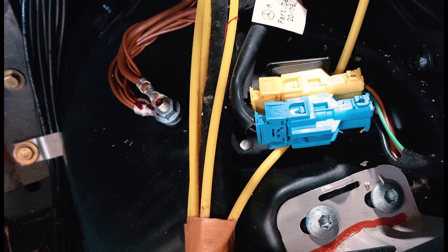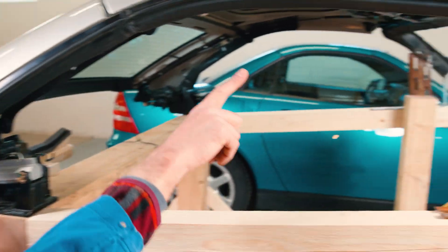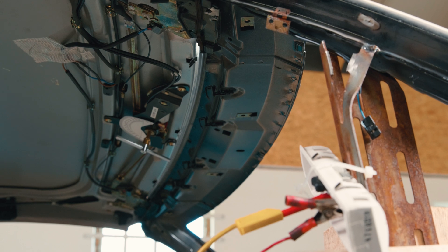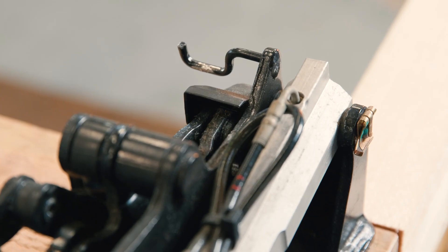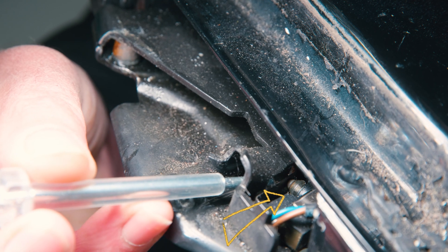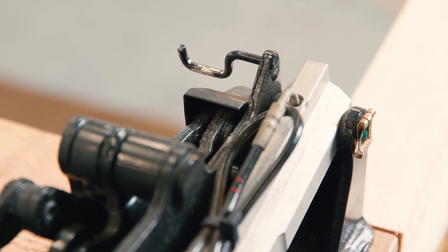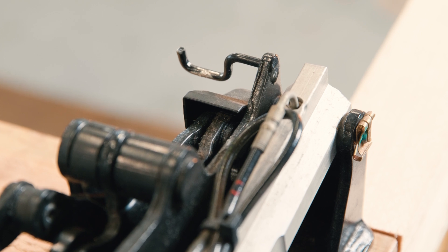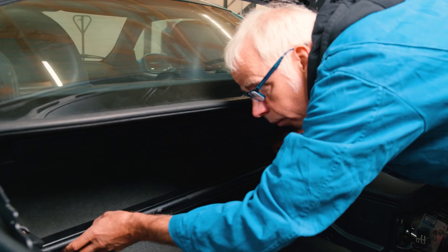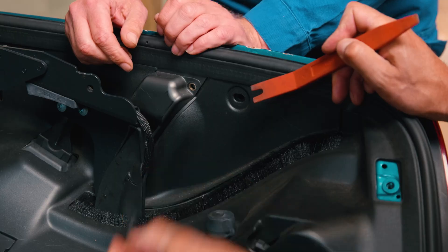After the front cross cylinder has set everything in motion for the roof opening and the rear cylinders have received pressure, we look at the end position switches in the covered area behind the C-pillar. Next to the blue connector for the rear window heater, there is a yellow connector with wires from the front roof that can be easily tapped into. The end position switches in the roof close in series after the front locks have successfully engaged — a ground circuit is completed, signaling the fulfilled conditions for subsequent control unit operations. The roof frame switch exists only on the right side, as does a switch at the C-pillar joint that detects the folded roof. That's four micro switches so far. The switch on the luggage roller blind on the right side has often proven important.